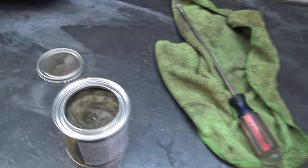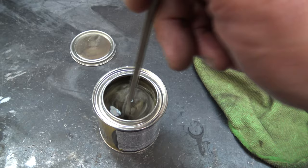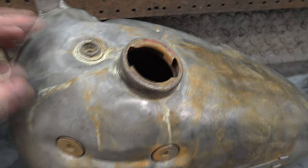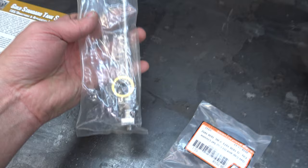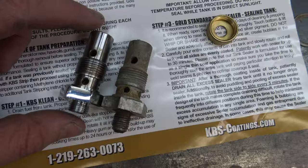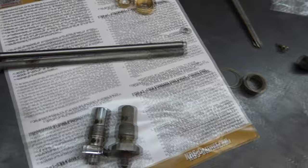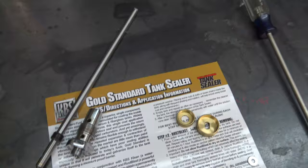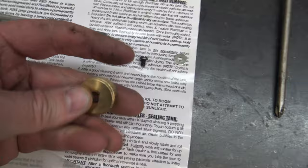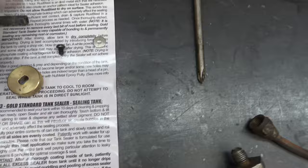Here's the sealer — you're supposed to carefully mix this without getting air into it. I'm going to mix this up real good. I feel some chunkies in the bottom there. I'm going to plug these holes. I'm actually going to use the original petcock, top and bottom. Because we have a new one, I'm just going to check it and make sure the threads fit. I'll use the gas cap that came with it — we have a new gas cap too. That seems to fit on there pretty good, looks nice. For the aftermarket, this piece is a different outlet than this, and the rods are even ever so slightly different. I think I'm going to use this top hardware when we're done, but just for the sealing part I'm going to use the aftermarket stuff. The top piece doesn't fit on this rod — it has different threads for this cap screw. Not a very good kit in my opinion.